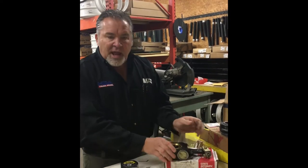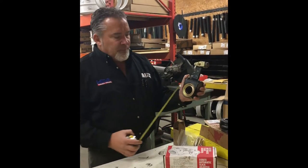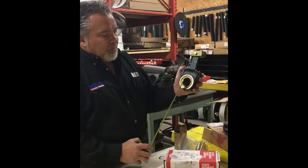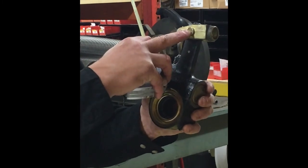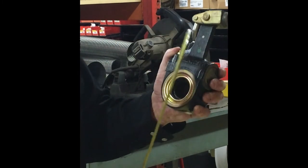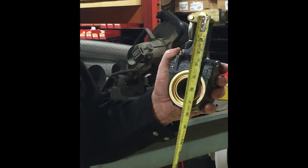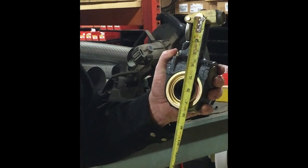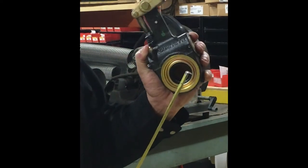Once you figure out it's an inch and a half and whether it's fine or coarse, you're going to need to know your increments from the center of your camshaft hole to your mounting pin for your clevis, for your brake chamber. This particular one right here is what we call a six inch increment. They come in various shapes and sizes, and that's how you're going to clock your slacks when you install them.